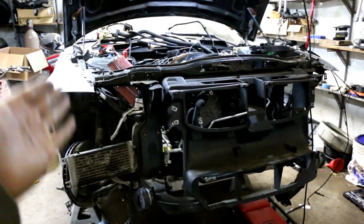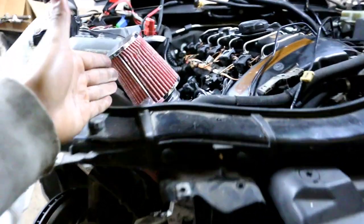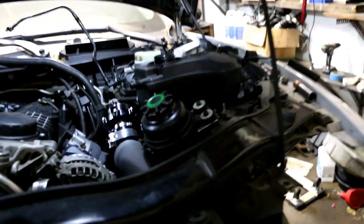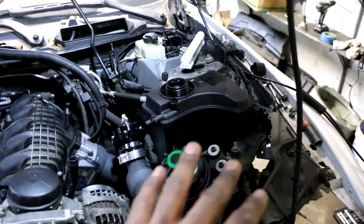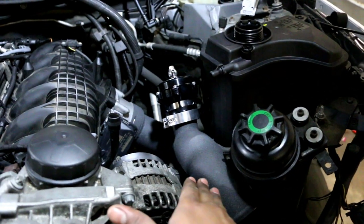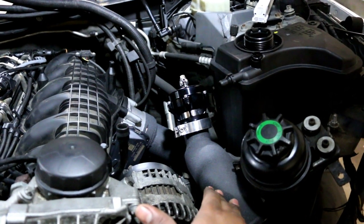Right now I'm trying to tackle the relocation because with the intakes on this side, we can no longer put the coolant reservoir on that side — we're gonna have to move it over. This is the original coolant tank. I have a coolant tank from a 335D, which is a turbo diesel, and on that model the coolant tank sits on this side. You can see how I got it mocked up here with the power steering tank, charge pipe, and a charge pipe from VRSF specifically designed for the 335D.